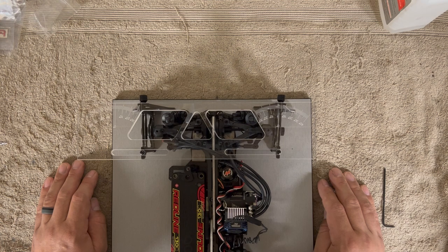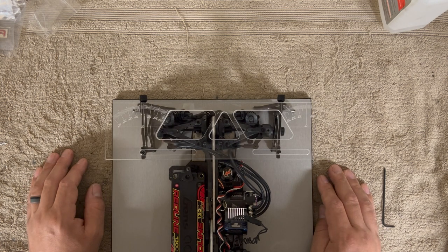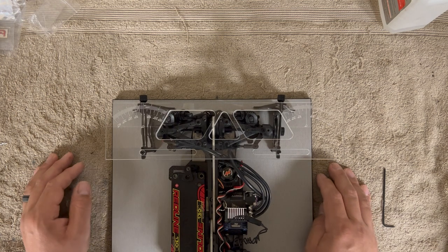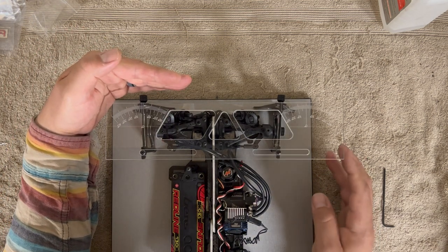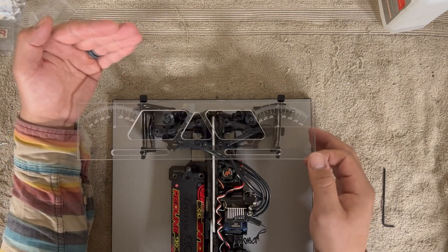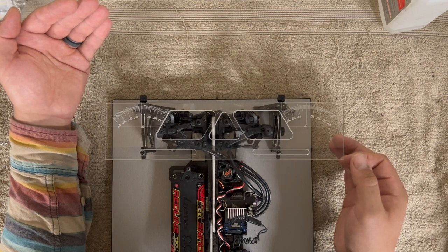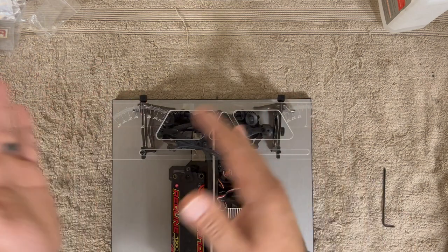I don't think I want four degrees — I may go down to three. Let's check the other side. That side is at two and this side is at four — so that's way off. I want them both at three. The Allen wrench is what I need here. This one at two needs to have the link closed, and the one at four needs the link extended.